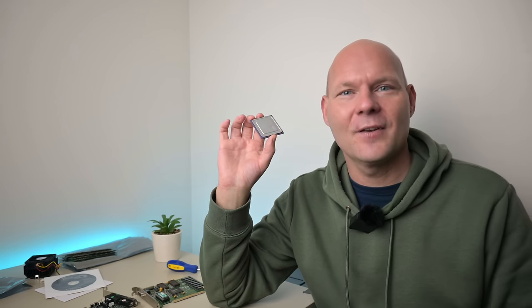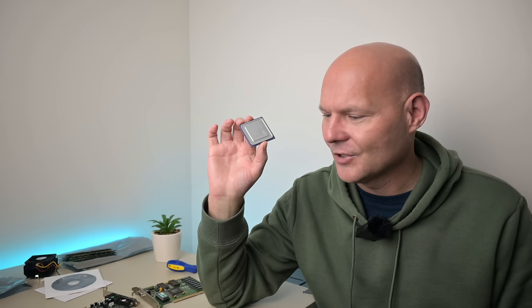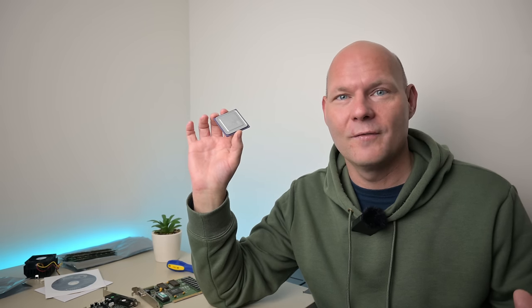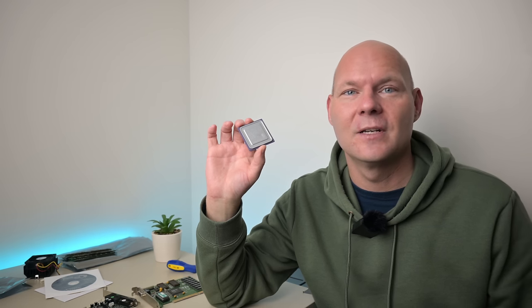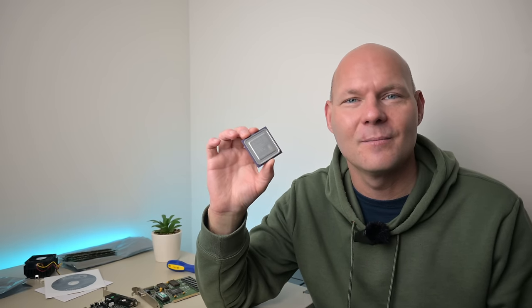So while this was fun and it was interesting seeing how much performance we can squeeze out, I think it's not something I would recommend. It doesn't really resonate with me. If you want a machine that performs well under DOS, go with a Pentium 3. That way you can still get ISA slots. Or if you want to ditch ISA, go with a Pentium 4, but then you need to find a DOS compatible PCI sound card.